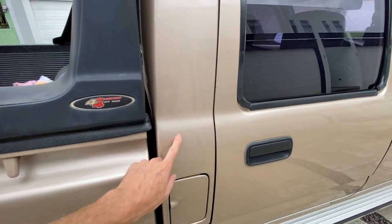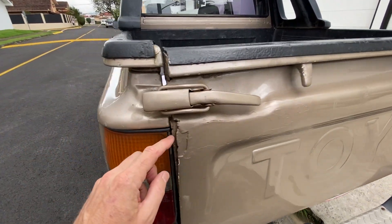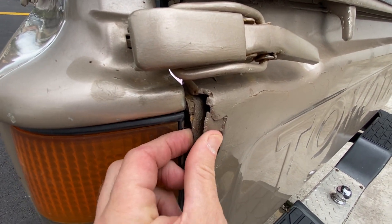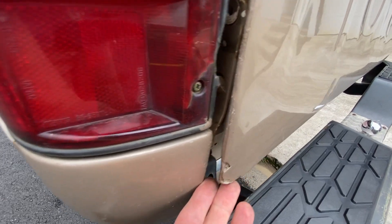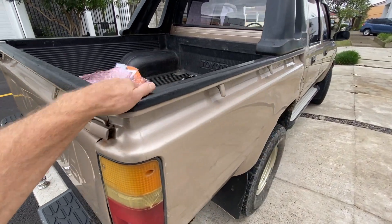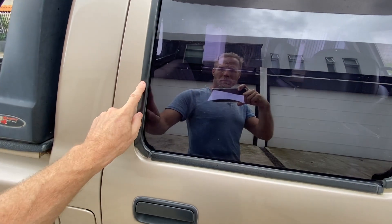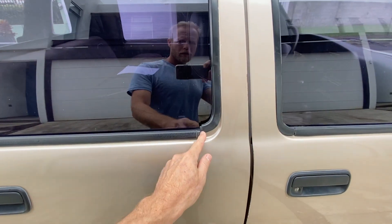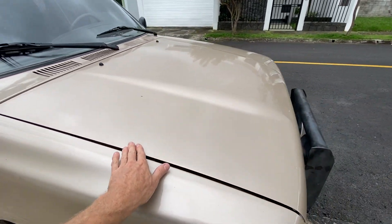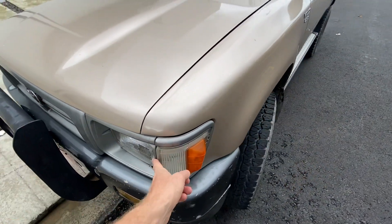Lines are good but our tailgate's pretty bad — we're going to have to look for a new one. So we're going to find a new one of these. But everything else — this is going to be a stage 2 restoration, so we're taking off all of this nonsense. Glass comes out, replacing weather stripping and moldings — these kind of shrink up over time. And although our hood is nice and clean, we're going to redo this as well. Clean up the bumper, take off the bull bar, replace the lights.